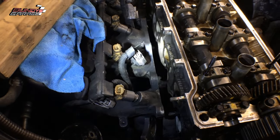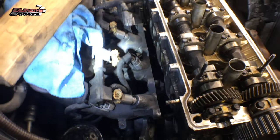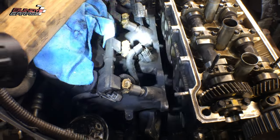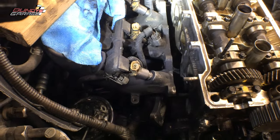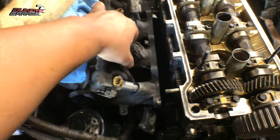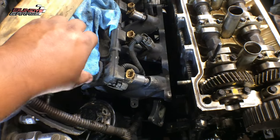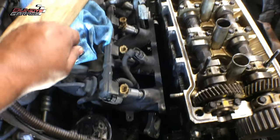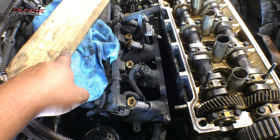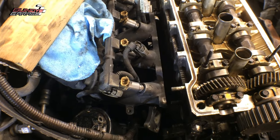There was also a line for the water pump. The water pump actually has a rubber line that goes onto the back of the head. Then you go around, get the timing belt off, and then get the exhaust manifold off. Towards the driver's side, you get all that stuff off — your thermostat, thermostat housing, and coolant lines over there.